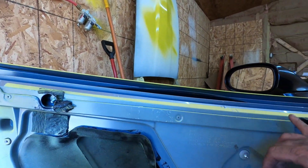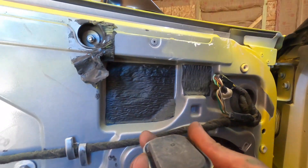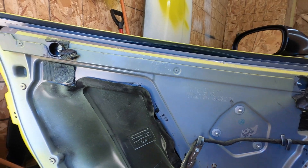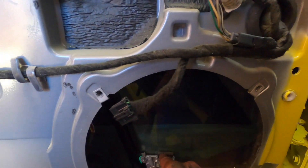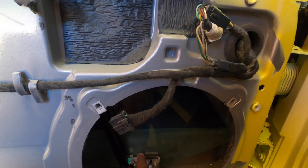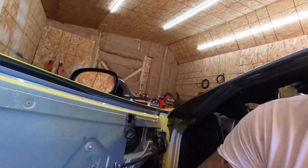I'm going to put everything back together. One thing I want to note is the nuts inside — the one under here, you have to pull off the rubber grommet that sits right under there to block that hole. But other than that everything's pretty straightforward, nothing crazy. These are all 10mm bolts and it comes in and out perfectly fine. What's very nice is the window has rubber pads attached to it and you pretty much just set it right in — no adjusting needed. I threw it in and everything worked perfectly fine.